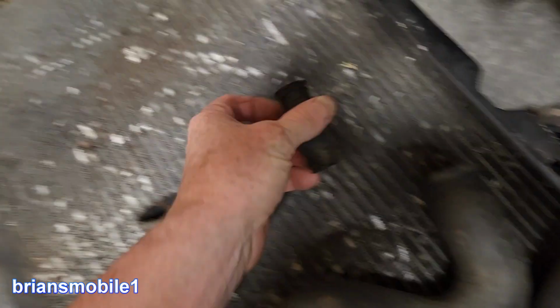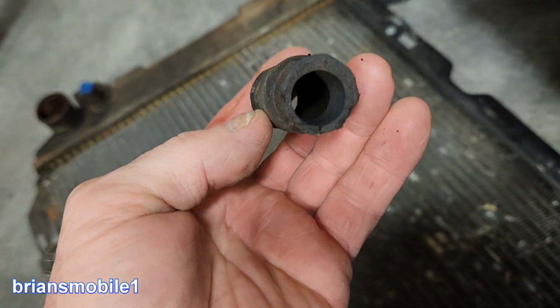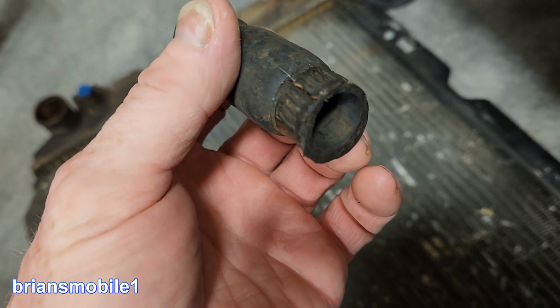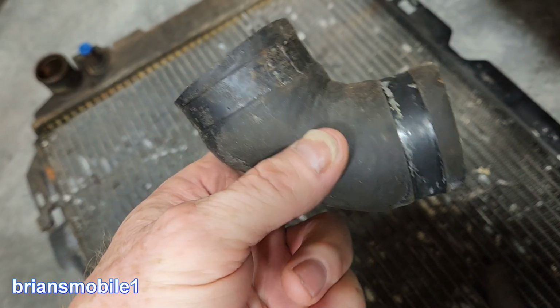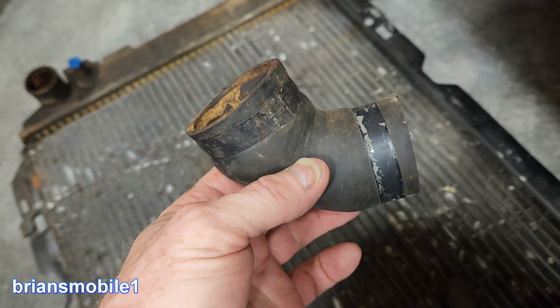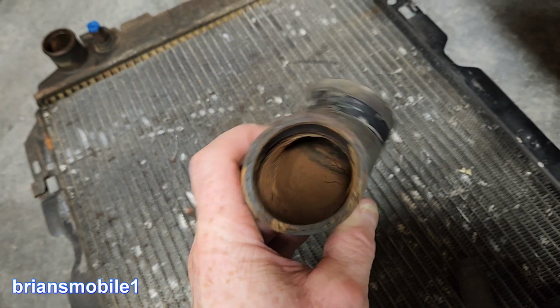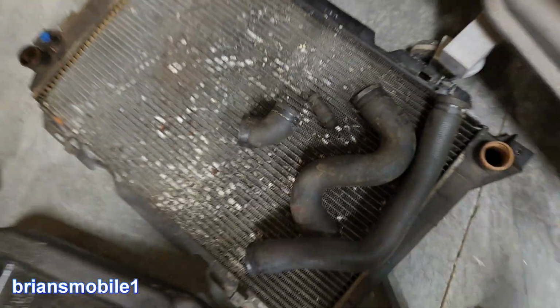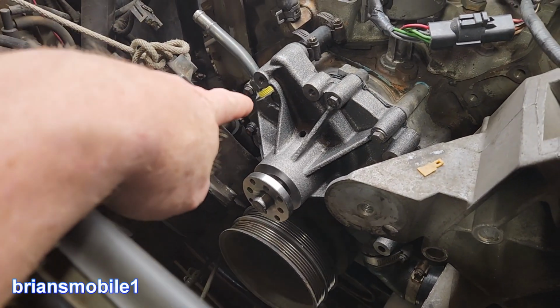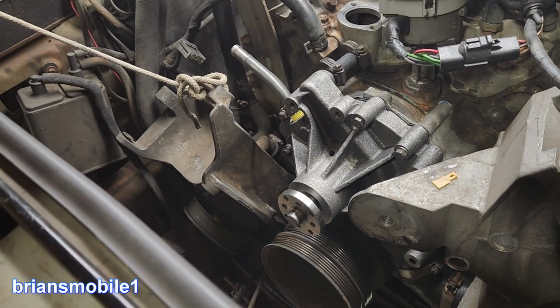We had to replace these hoses, so don't forget to put new good ones on. You can see how inflated and blown out this is. And then it's also starting to split right there. And then this is that bottom hose that goes to the oil cooler. So it would be on like that. And they all run just straight and even with it. They're not twisted out to the side or any other kind of funny thing. They're all really straight. Also, make sure you use good Teflon tape on that. Clean all the old stuff off before you put that on.